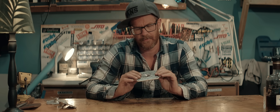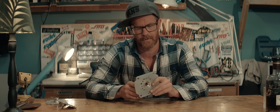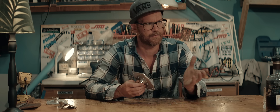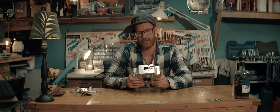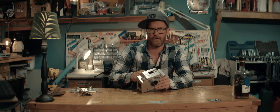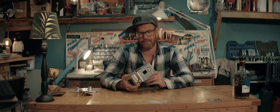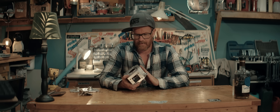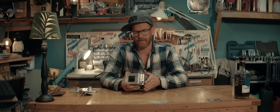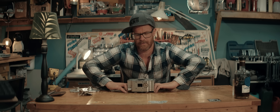That head destroyed itself from compression. I machined a new one, created a big radius, and that solved the broken head problem. This head is 14.5-to-1 compression, and what's in the engine now is 20-to-1 compression — that's static compression on the two-stroke, lower in practice. Getting tired of breaking reed valves, and I have a theory about not having enough exhaust blowdown. So I designed and machined a new cylinder — the old one is here, the new one is on the engine — with twice the exhaust blowdown area, two exhaust ports, and a different port layout so I wouldn't need those reed valves.